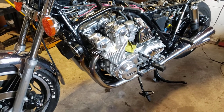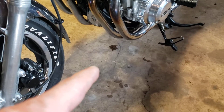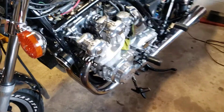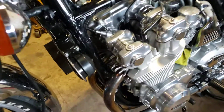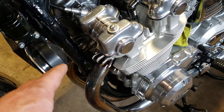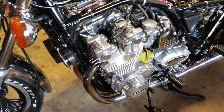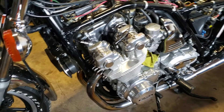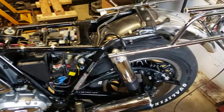I've got no leaks. The one little spot of oil you see there is from when I had those oil lines hanging down when I had the engine out — they dripped there a little bit. But yeah, so far so good. No noises, no leaks. I do get an exhaust leak up here — what I usually do is get them hot and then snug them up while they're hot. I notice one of them starts leaking a little bit every once in a while, but that's just part of the process.